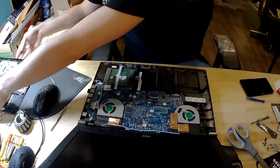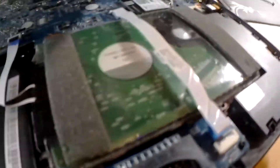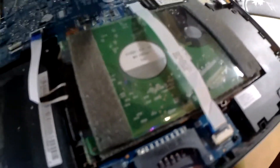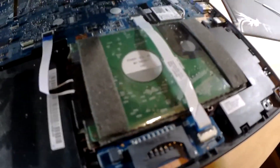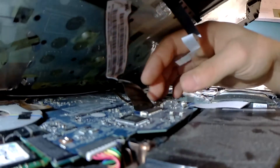Now, in reverse order, I'm going to put the keyboard back. As an aside, this is also a really good time to install a new solid state drive or M.2 drive if that's what you want to do. The M.2 drive slot is right here — you just pop it right in. Probably the easier upgrade to do. I'm going to start with this big ribbon cable. It just wiggles its way in. Do your best not to kink it, of course.